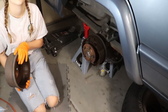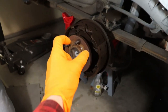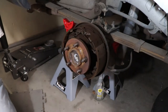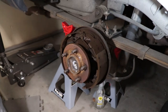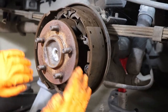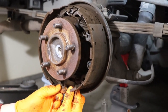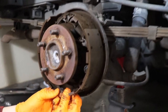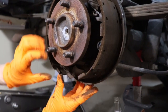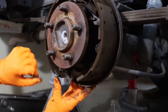Because we're going to be priming the brake, we want the drum on there so that if the pads push out, they're not just going to keep going free — the drum and everything is assembled. We're having a little trouble getting the drum on because the shoes are just pushed out too far. So I'm pulling out this little tab here and screwing this down so that I can pull these shoes in a little bit, and then we should be able to get the drum on.